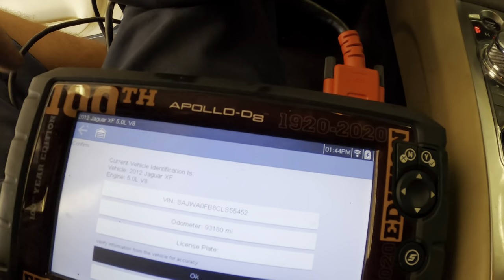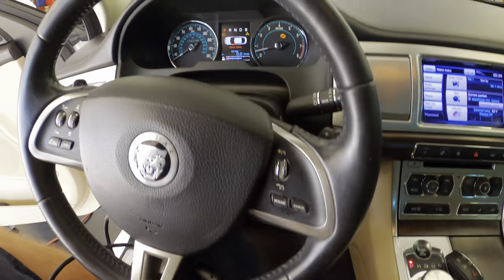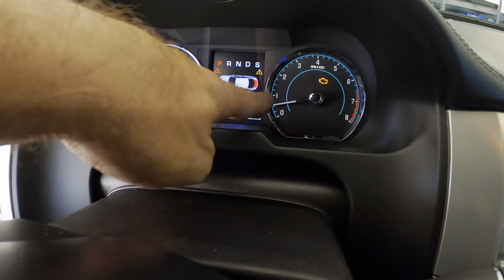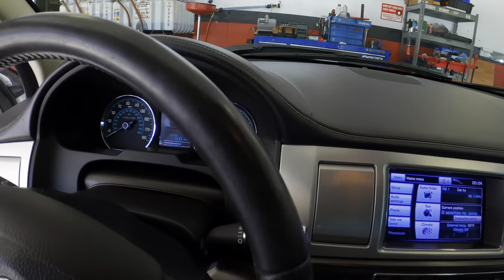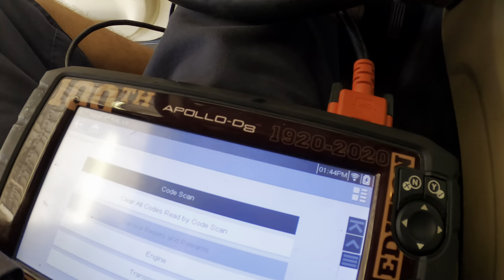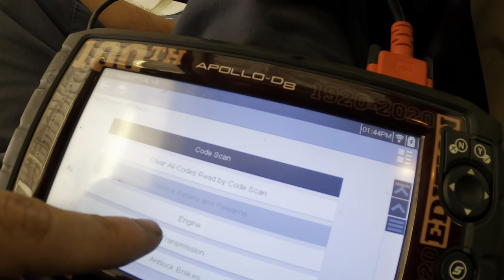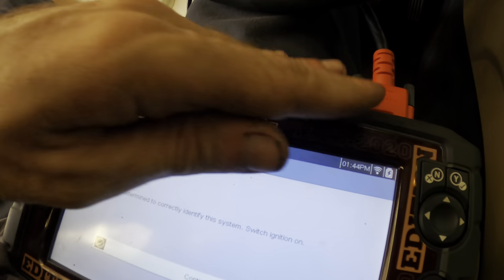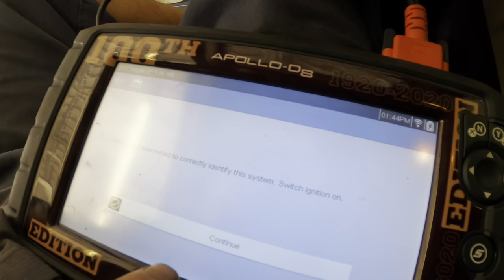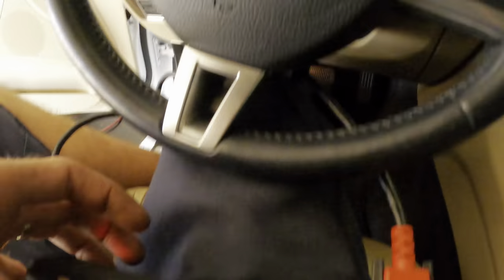Trying to get a big picture painted here so I can make a decision on what we're going to do. It also seems to be misfiring — you see the tach right there, how it's bouncing, and the whole car is kind of shaking left and right. So I don't really know what's going on, because all they did was ask me to check the battery, go figure. I have to employ some strategy here to determine what the problem is. I got a check engine light on and no trouble codes — this is getting good.